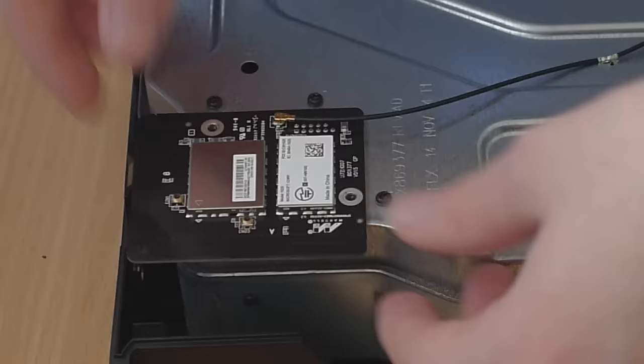We'll be doing a tutorial on how to swap that white LED light out for a different color, probably in the next video. If you want to take the disk drive out - just unplug it, simple as that. They're not screwed in because we've taken those long screws out already. My disk drive model is DG6M1S-02B. If you want to take the motherboard out itself, there are more screws - four screws holding the heatsink in place with X-clamps, and a couple more screws here and there. Take those out and you should be able to lift the motherboard out without any major issues.